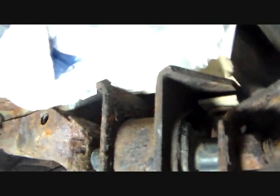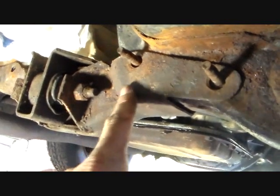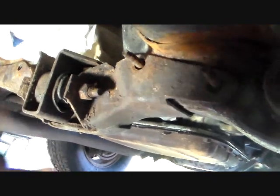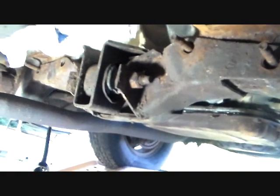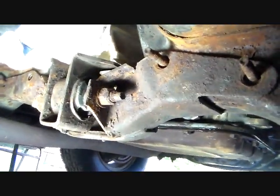And what I'm doing right now is I've put the 2 bolts in. There's one there, and there's one back over here that hold that transmission mount to the transmission. Well, this thing's in 2 pieces, I guess you could say. It's got the bracket itself, and then there's the mount. If this thing ever fails, that's what you buy, is that part right there. And I've actually got a spare one of these, and I've got a new mount, but I decided not to use any of that because this one's in worse shape than the one I have as a spare, and I don't want to use my best one on this car, so I'm not going to. And plus it does not need a mount. The mount looks good, so that looks real good actually.